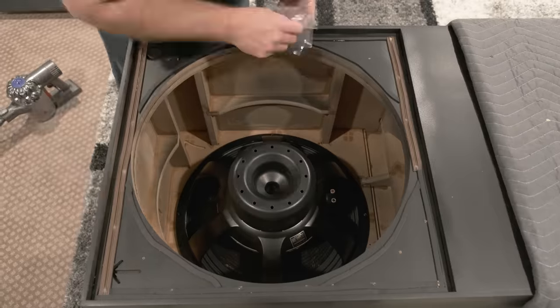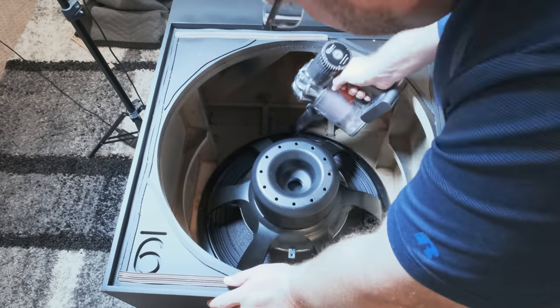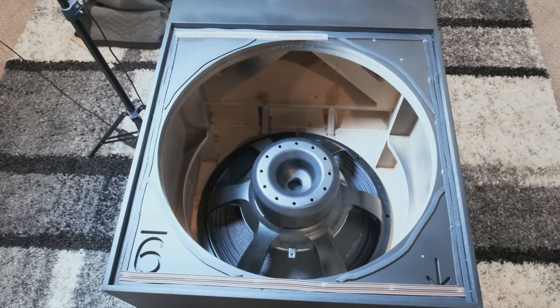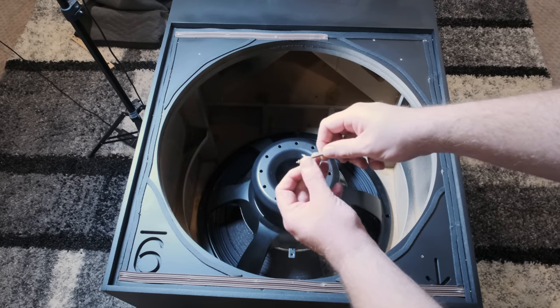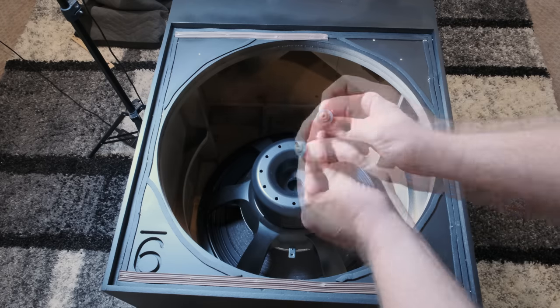Be very careful when you put this speaker into the cabinet. It's super magnet heavy, meaning that it wants to flip over. So you're likely to be putting it in just like I did, cone down with the magnet pointing up. And just be careful, because it absolutely wants to flip that magnet down. It's really heavy and it's way out there.